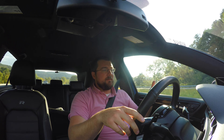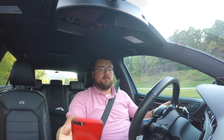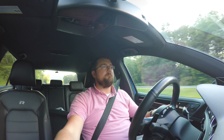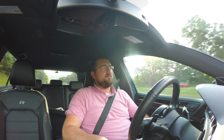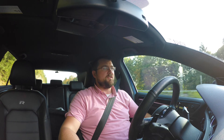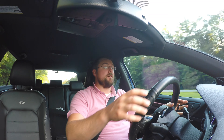We're about 10 minutes in so let's wrap this up. Oil change — obviously, might as well do that. I should get a picture of my odometer for my oil change records. New oil, new oil filter. Oh — new spark plugs. They only had 2,000 miles on them. I had a misfire issue one day which I attributed to bad gas with the recommendation of mechanics, and it hasn't happened since. I had the spark plugs on hand and did it anyway — spark plugs are really cheap compared to the damage that could occur from bad plugs.